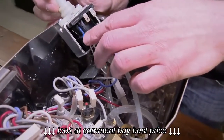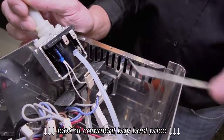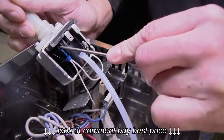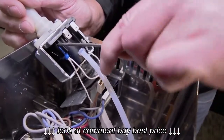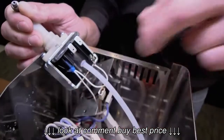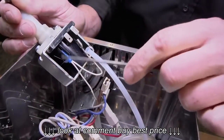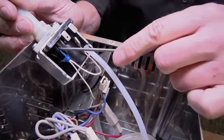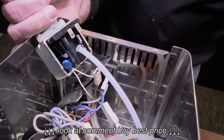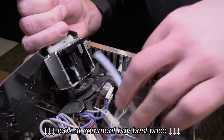Now we have this thermal fuse — if the pump ever overheats, this will trip and shut the power off to the pump. In order to get it out, I usually take my little pick and go up as far as I can behind the fuse in the opening, then pry it down so it starts coming out so I can pull it the rest of the way. Sometimes they'll pop right out; sometimes they're a pain because they use hot glue around the bottom of it. Once you get it to slide out, set those two wires off to the side — it's the only wires we're going to disconnect.